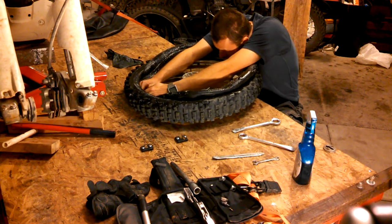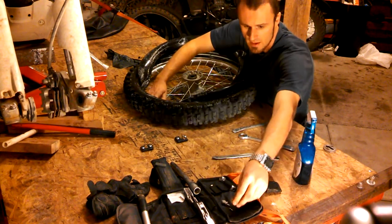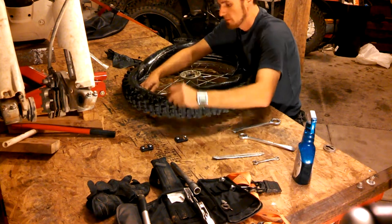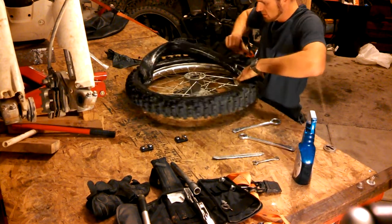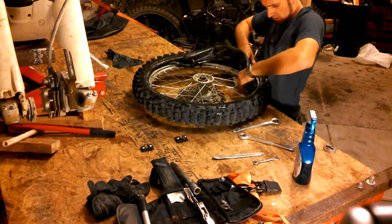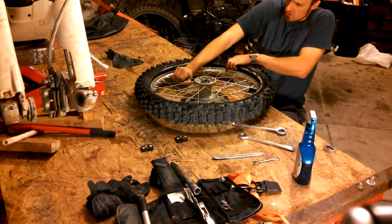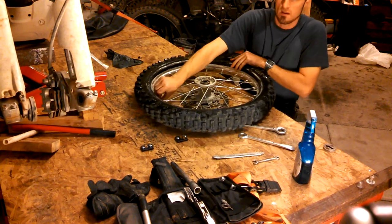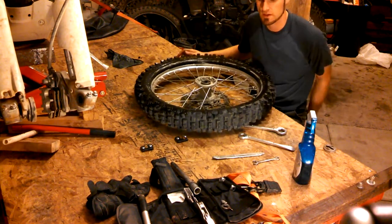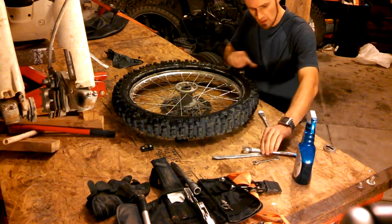Push it in — it's almost there. The valve is in. I put the washer on just the tip of the valve to keep it in place so it doesn't come out. The tube goes back in nicely over the rimlock. Make sure your valve is sticking out — sometimes you have to spin the tire a little to get the valve exactly perpendicular to the rim. You don't want that valve to come off — that's why I broke it the first time.